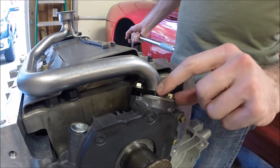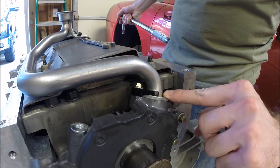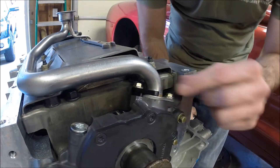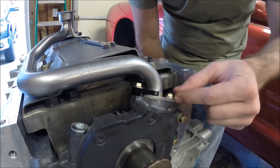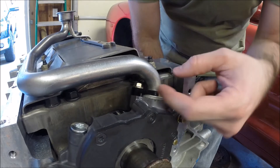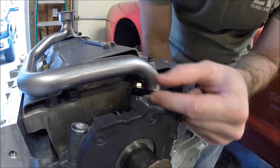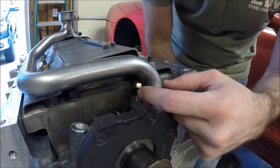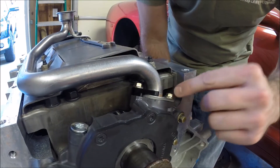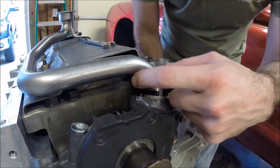This took a little finagling to get in there. Once the pickup tube is fully seated, there's not enough vertical clearance to get the bracket and bolt installed. What I had to do was back this bolt out until it was just barely on a thread to keep things centered, then pull up on the pickup tube and work the bolt and the little bracket together in there. With your fingers, get it started and work it down, and as you do, slowly seat the pickup tube, then tighten things in gradually. There's no way to get a torque wrench on this one, so just get it snug.